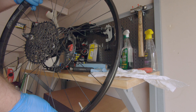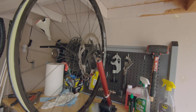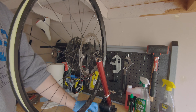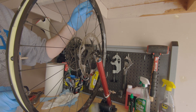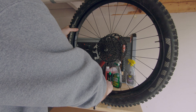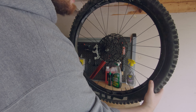It's a lot better than it was before, so I'm gonna go ahead and mount the tire back up. Before mounting the tire, it would be good to go through and true the wheel — as you can see it isn't quite straight anymore. I'm trying to do this as carefully as possible because it's filled with sealant and I don't want to spill any. Just a little bit more in to top it off, and let's put this all the way in.